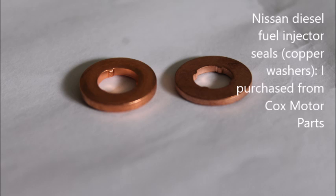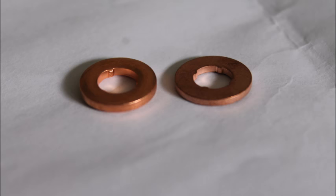Just a quick word about the new copper seals. You can buy a Mercedes one — you can see it on the right-hand side here — but on the forums a lot of people recommend a Nissan copper seal, which is on the left-hand side. The suggestion is that the Nissan one is better because it's a little bit thicker and a little bit softer, so it's more forgiving if there are any scores or marks on the seat or the bottom of the injector. I actually measured both: the Mercedes washer is 1.5mm and the Nissan one is 2.4mm. These will still seal properly because the clamp brings the injector down until the seal starts to squash slightly — so as long as you apply the right torque, you can use the Nissan one, and those are the ones I used. Details and part numbers will be in the description below.